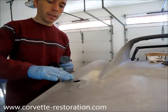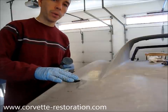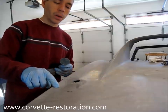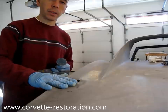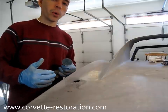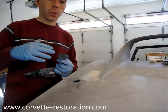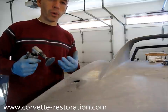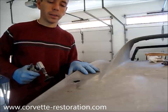The goal here is to dish down the area around the opening and create a seamless repair. From the top side, we're going to go halfway through the thickness of the panel, grind down, and feather it back a couple of inches into the surrounding area. We're going to apply our fiberglass mat with our resin, add a couple of layers as necessary to build back up to the existing surface. Then we're going to repeat the same process on the underside, so what we end up with is a panel that is 100% fiberglass all the way through with no gaps or voids — a full structural repair. So before I get grinding, I'm going to put on my respirator. I don't want to be inhaling this fiberglass dust.